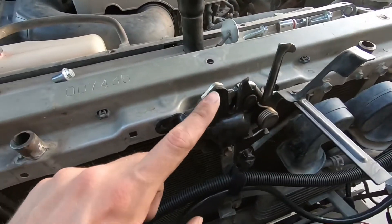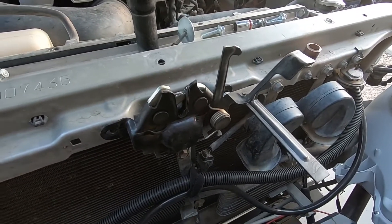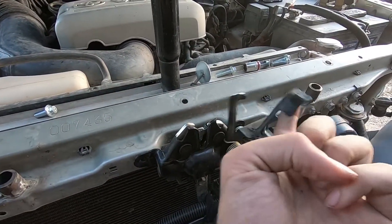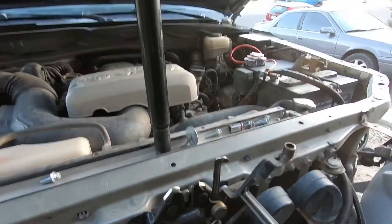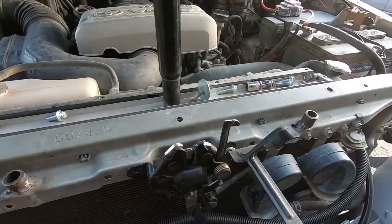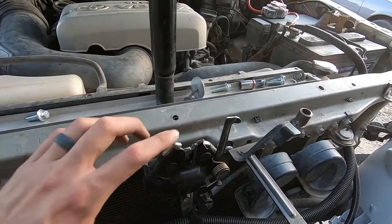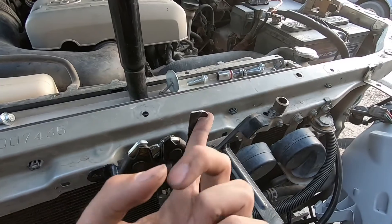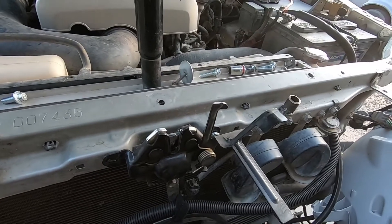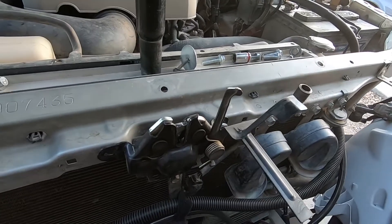I also forgot to mention — I added a Tacoma hood latch. It fits the same exact spot as the OEM hood latch, so there's no change there. The only thing it adds is this hood catch. On 4Runners, the hood catch comes off the hood down, so you don't have a hood catch. Even though the 4Runner hood clip will work, you won't have this little extra piece of safety, which I really like having. It's a lot nicer to have this than to have hood pins, and it's easier to install.